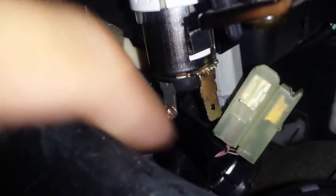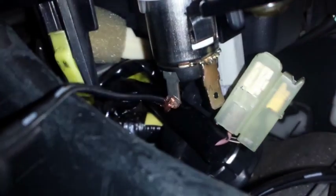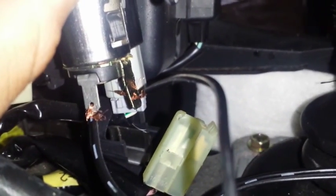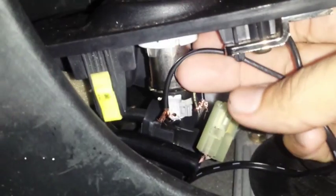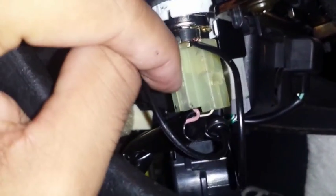We need to connect it into that hole. I'll just wind it through the hole and twist the copper back on itself. When the plug goes back on it will hold it all in firm, so there's no need to solder. I'll do the same with the negative - the negative goes in the hole, then just twist it back on itself again. Hold them upright and then insert the plug back on. Now I've pushed that plug up to the top and it's locked in pretty tight - it's not going to go anywhere and the wires are still connected.